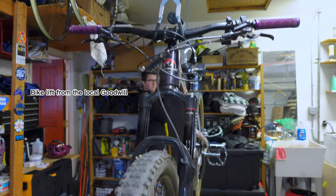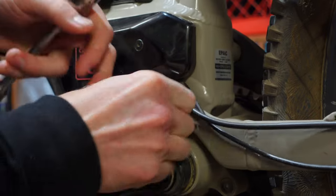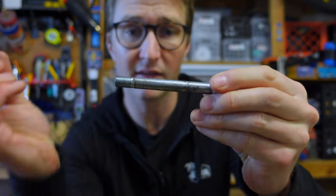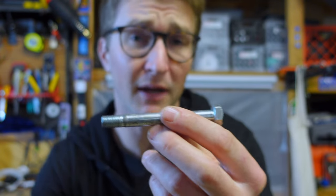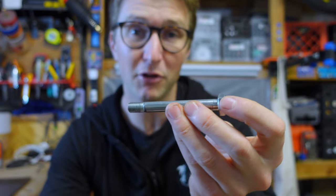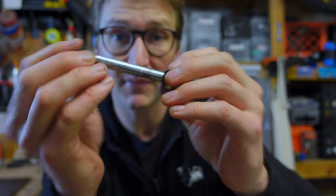After 30 miles of trail riding, let's take a look and conclude. So, 30 miles of hard trail riding — no real signs of wear on this Lowe's bolt. I was concerned about it being soft because it's stainless. I think the other one is probably a hardened aluminum. If you were to replace every bolt on this bike with hardware store bolts, it would be a significant weight increase. For just one bolt, and especially the main pivot, I'd argue this is a pretty good solution. The little homemade washer is still intact. I was concerned about this cracking because of the stresses that were going to be put onto just a small aluminum washer — but no problems here.